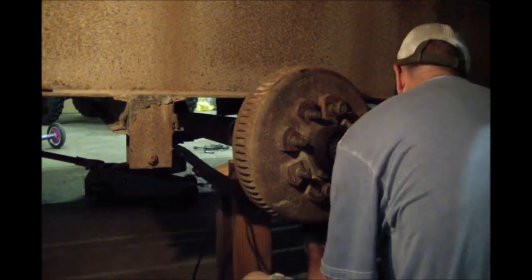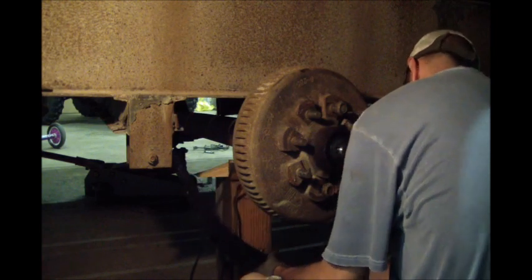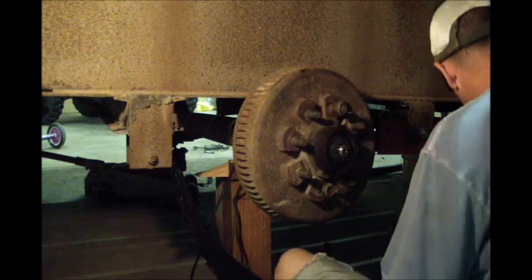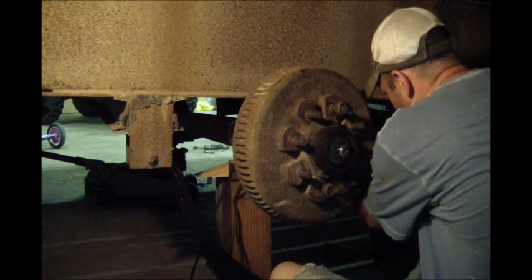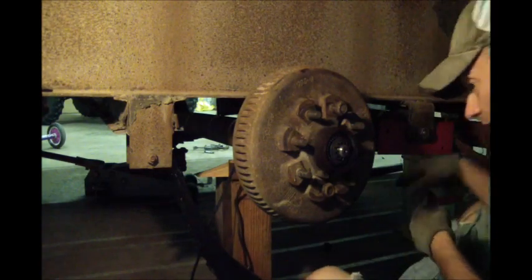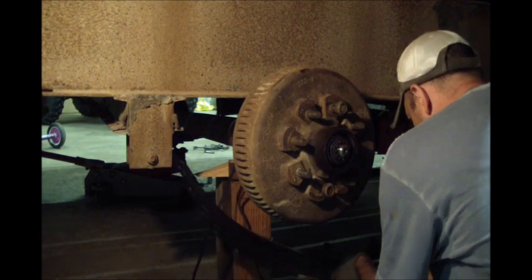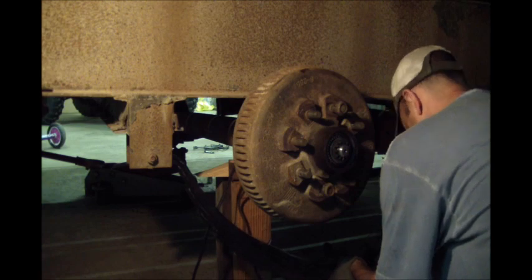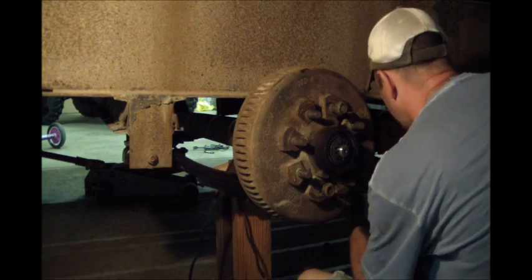That's got me high enough. See, that just hangs on one side, so it's pretty easy to get this spring up, and then I'll get the axle in place where it needs to be once I get the spring in here. Let's see, I might use just grease this perch with some, I'm just using some white lithium grease.